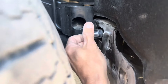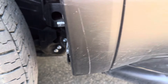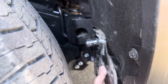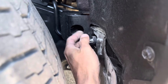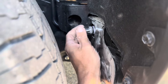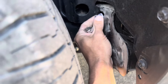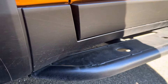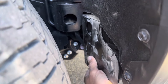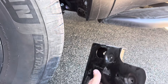I'm going to attempt to do this with one hand to show you guys. You can see this is the stock clearance — here's the plate with a little felt piece that we removed. This guy was just aesthetically covering it, but this is what you're left with stock. With a 17 millimeter socket, he's out. Then this thing's going to flop around — that's where those tabs are. So we go up, slide, bring it down, and it comes right out.